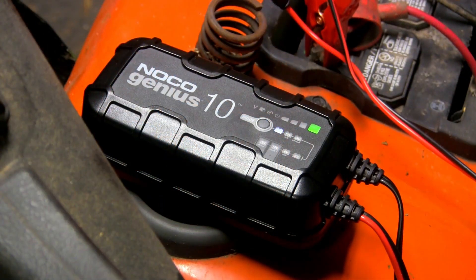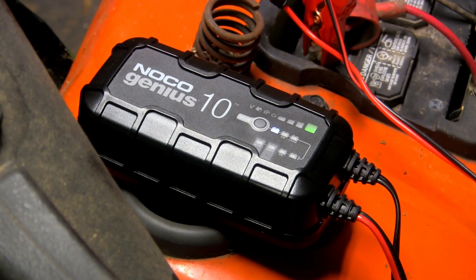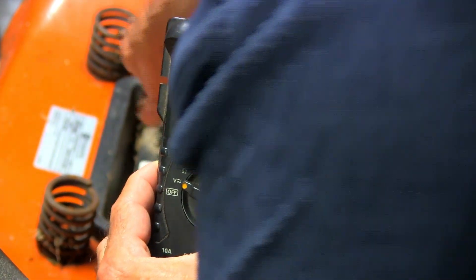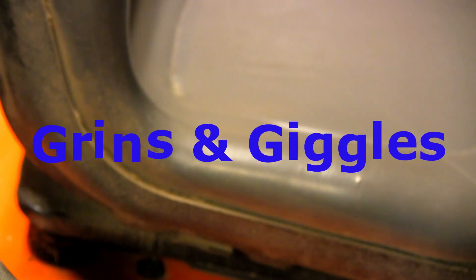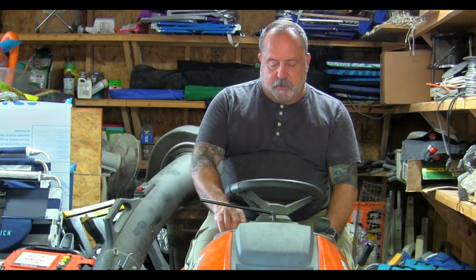It's in repair mode overnight. I came out earlier this morning and put it in charge mode; a couple hours later it has a solid green light meaning the charge is complete. Voltage reads 13.07 volts — that's a good charge. The real test is starting the mower, and it fires right up. That's from an 11-year-old battery. The repair and charge cycle worked correctly and we're still good to go.